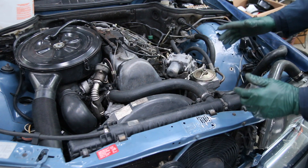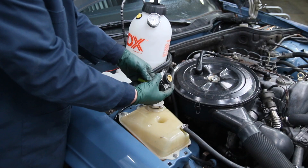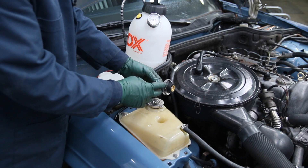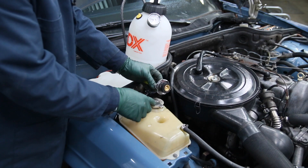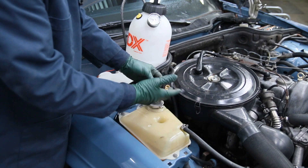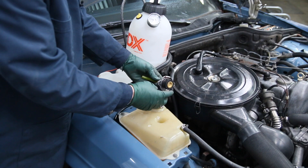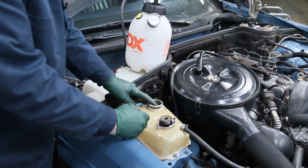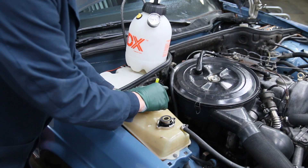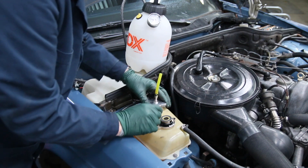Right away you'd want to do a pressure test, and we've just completed the final prototype and we're ready to go into production. Let me show you how that works as I pressure test this 300SD. Here's the final design — after about two weeks we're ready to ship. This took a lot more work than originally thought because you have to be absolutely certain the seal is 100% against either the coolant reservoir tank or the radiator, or you'll get false readings. There are a lot of parts and machining in this cap. You just remove the old cap, clean the seating area, and this cap is adjustable — back it out until you can close it, then turn it to tighten down just like a regular cap.